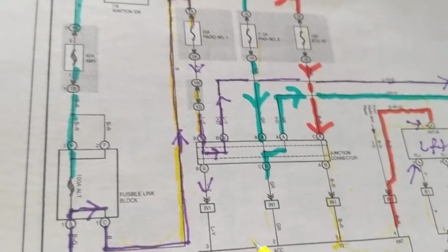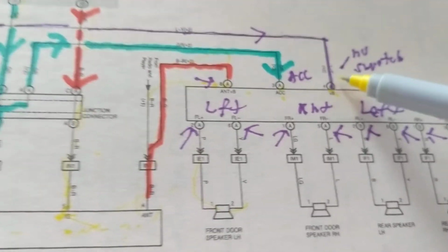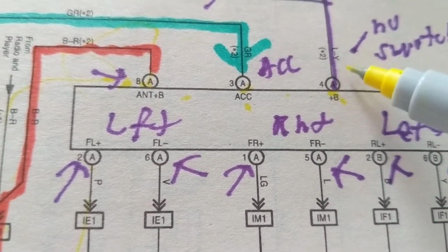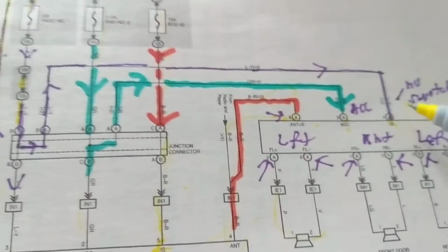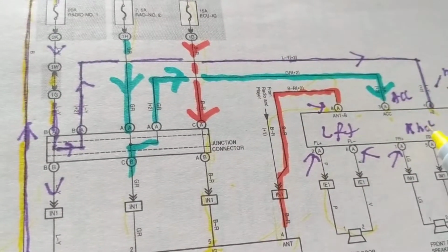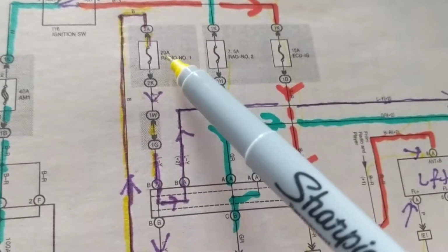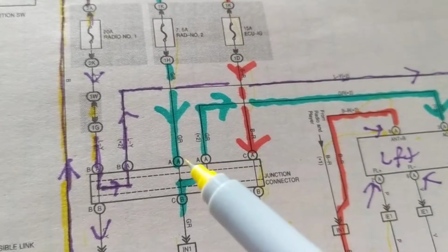Chassis is ground, right? So let's take an example. Let's say this one broke off, the B+. The B+ broke off, as you see over here, I believe it's light yellow, broke off from the connector. Now, it broke off and it touched chassis. That's going to blow a fuse. Even though it's open, it's still a short circuit to chassis through the B+. It'll blow this fuse. So, when you have something open in electronics, usually you're pulling less current.